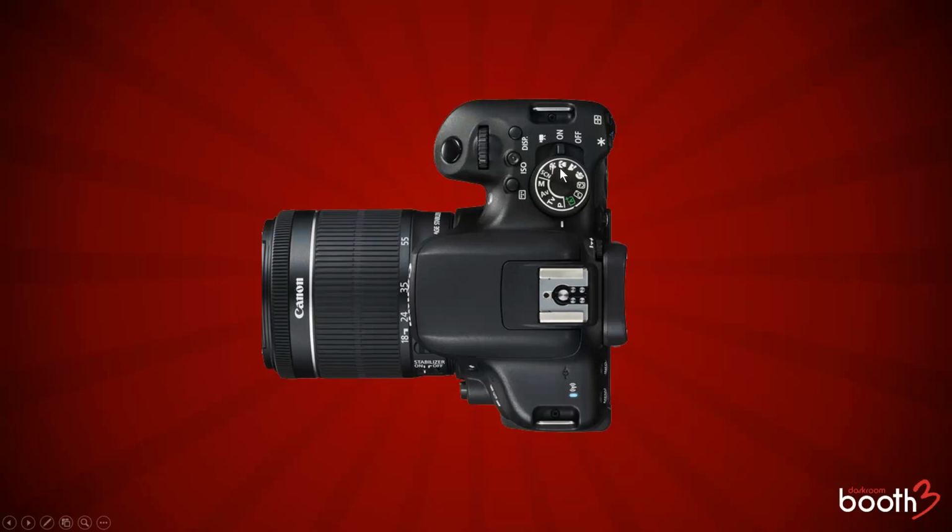Some of the specialty modes on some cameras, such as sports and so on, turn off the live view. So if you have a situation where for some reason your live view is just not working, or it says live view not supported, even though it worked fine last week, it could be that you've got the camera switched over to the wrong mode. Most of the time when we see that sort of thing, somebody will say, oh yeah, I used it last week to take pictures at my daughter's birthday party or something, and they forgot to change it back. So just set it on M. That's the primary thing that we're looking at.